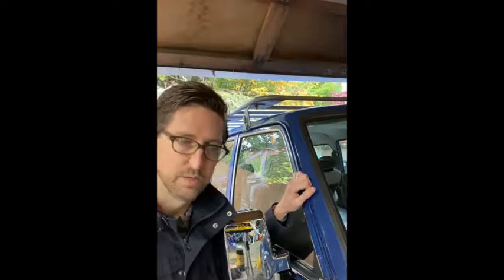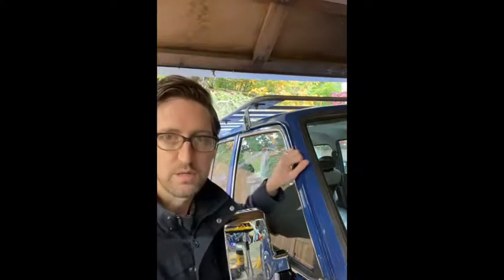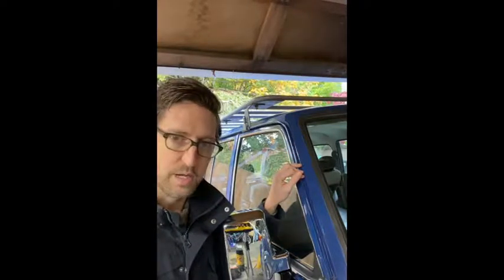So, the gutters: how to reseal them. If you're pressed for time and can't do it this year, we're limited by being garage-level mechanics. We don't have the luxury of heat-controlled areas, especially when you're considering optimal curing temperatures for paints and sealants, and it's getting cold. You can do a thin bead of a high quality urethane sealer over the top of your old gutters to buy you some time if they're not too bad. But to do the full job, we'll get into that right now.